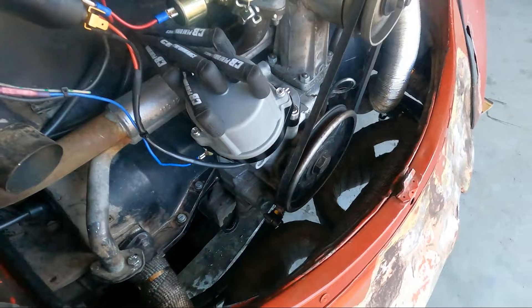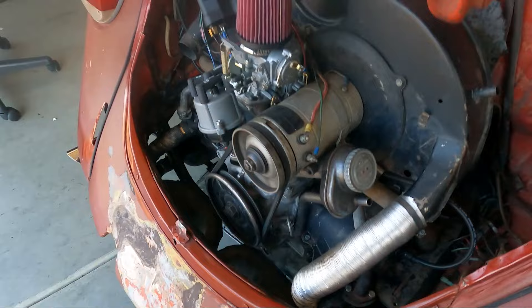The exhaust is steaming a little bit, so I think I got it a little oily. Other than that, I don't think we have any leaks. Everything's dry underneath. I've got no more flickering oil light at idle, which is awesome. I have probably about a half a quart more oil capacity than before, but most importantly I have a 10 micron oil filter now. That screen could hardly catch a piece of sand — but with a 10 micron Wix Racing filter, that thing's going to catch everything. I should probably change it in about 100 miles, let it go through a couple heat cycles and catch all that gunk since it's never had one before. It looks awesome — totally leak free, everything nice and dry. Super happy with it — I hope you enjoyed, I'll see you in the next one. Thanks for watching.